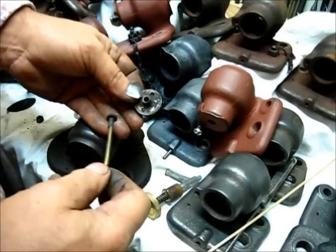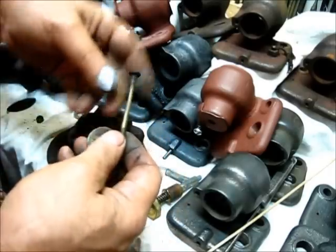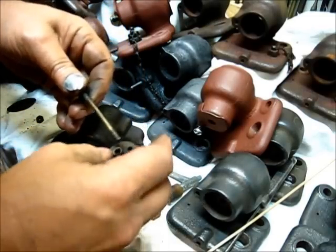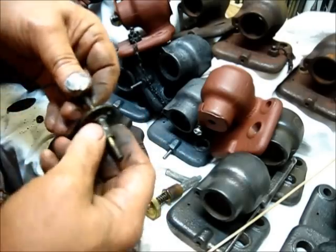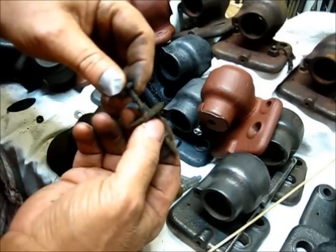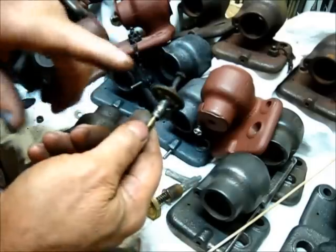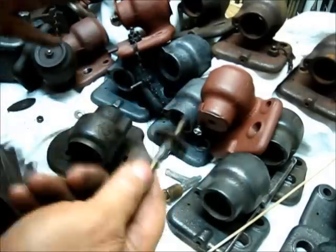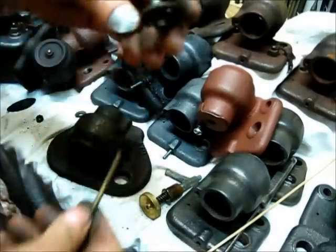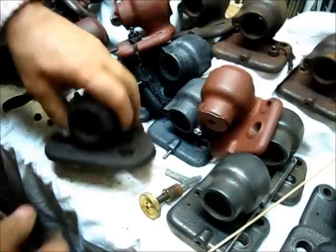It's quite egg-shaped. And the corresponding wear on this slide rod here — it's quite a bit. We're talking a lot of wear in there. Way more than a sixteenth. This would not have been good by any means. At this point, this is scrap — it needs to be replaced, and I will do that.